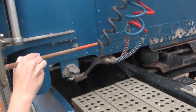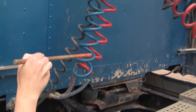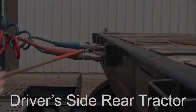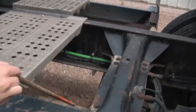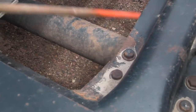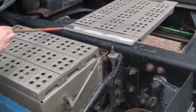I check my electric line here — make sure it's not down on the catwalk. I check the air hoses — make sure they're not leaking and the glad hands are secure. I check the deck plates or catwalks — all secure to the frame. I check the drive shaft — make sure it's not bent or twisted, secure with U-joints. And the frame is not bent or twisted with no cracks on it.